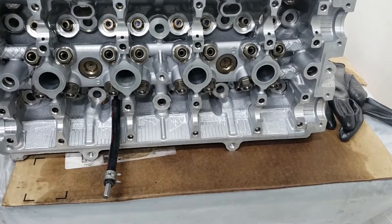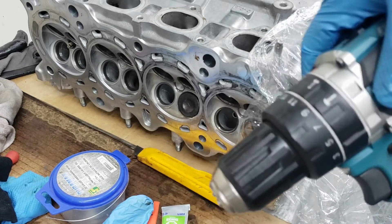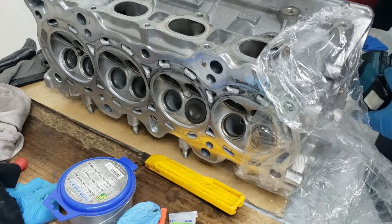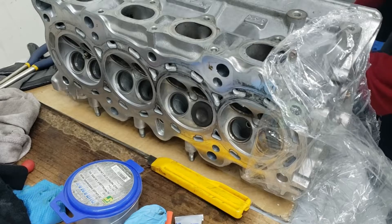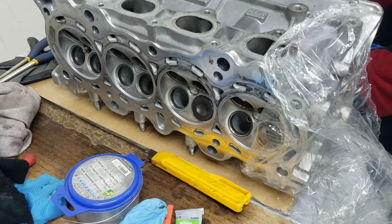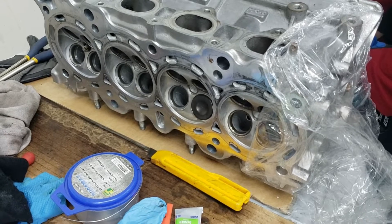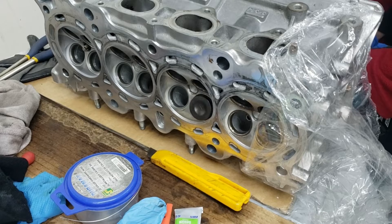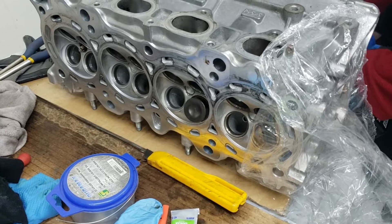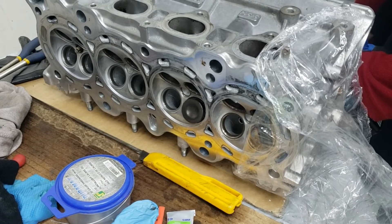I'll show you from the other end — this is the valve we're going to be working on. We just attach the drill to it. Then just work it like this for a good minute or so. You'll be able to hear the difference once the valve grinding compound is worn out a bit. Then you can wipe it off and check the seats. If it still doesn't look smooth, just keep grinding until it looks smooth. This is the faster process — it saves you a lot more time than doing it by hand.